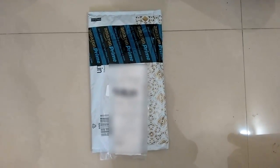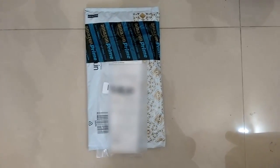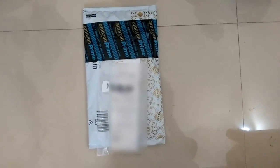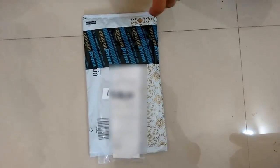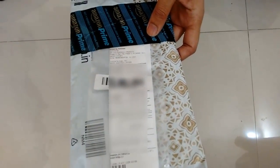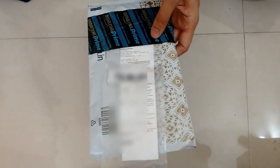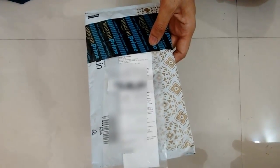As the RAM runs at 1.35V, make sure you go for the low voltage RAM as it is perfectly compatible with this laptop. Don't buy 1.5V RAM. I had ordered 4GB of RAM from Amazon, which costs 2100 Indian rupees. You can buy from Flipkart also. I am leaving the links in the description below.